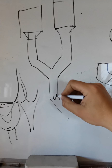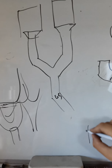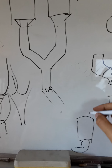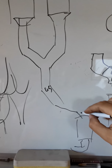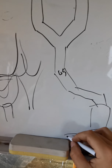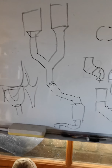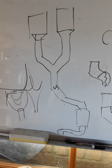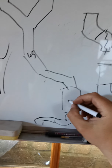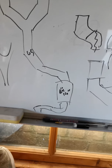This is obviously 1 45 degree here. Then the next 45 degree is down here to another silencer, and then we have a 90, and then from here we have a 45 degree. Sorry for the dodgy drawing, but that pretty much marks up how we're gonna do the exhaust, like so. This is all going to be 76mm stainless 304, and then this pipe here is going to be a 6" by a 14" silencer.